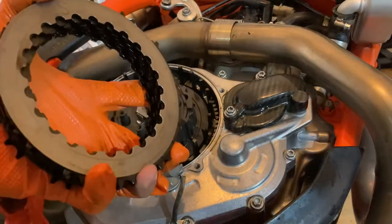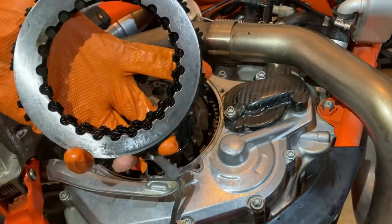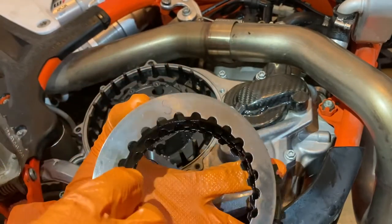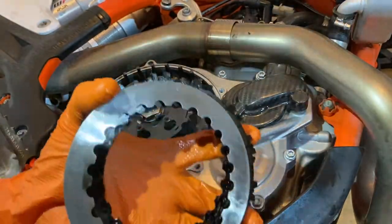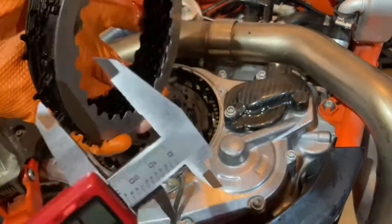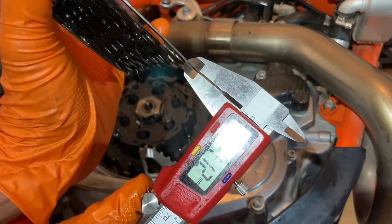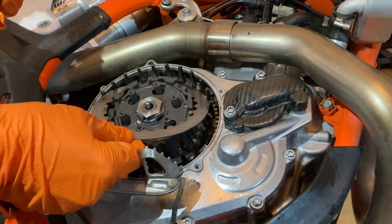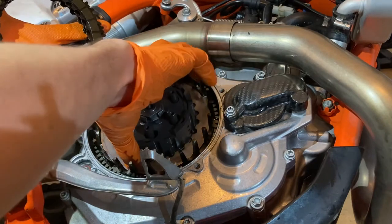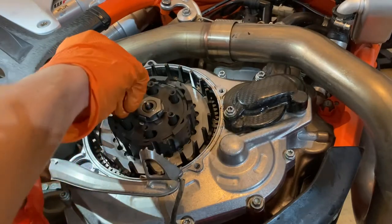Let's talk about the order of the plates — again, something you only find in the manual. Which side goes in first? The intermediate clutch disc has an S marking on it; that one goes in first. The intermediate clutch plates on the outsides are one millimeter thick — that's how you know which one goes on the inside. We want to have our sleeves in first. Without dropping them in the engine this time. These are essentially holding the clutch discs straight and aligned across the whole pack.